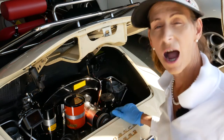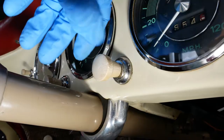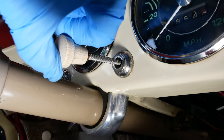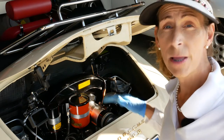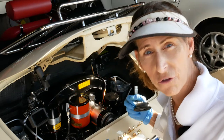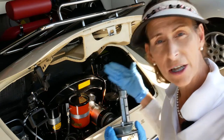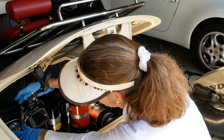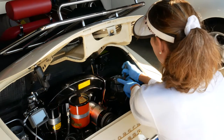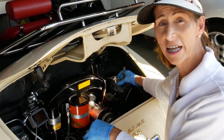I'm going to use that fancy throttle hold on the dash — pull it out and turn it off — to give us a bit higher RPM and test the linkage with the engine going faster. We have our engine going at about 2500 RPM and the carburetors are being pushed down by the throttle linkage. That's very important — we're taking the slop out of the whole system. Let's check with our flow meter: the left is just below the top flat mark, but the right one is pegged. That means the throttle linkage is a little bit out of adjustment.